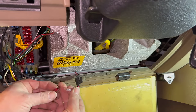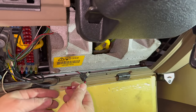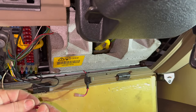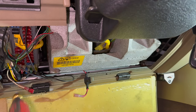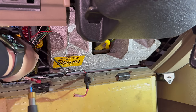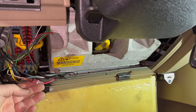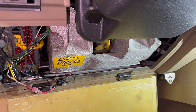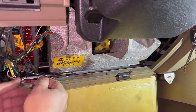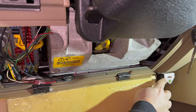I didn't put on this connector so I'm going to make sure that mine will connect to it before I crimp it on — I've made that mistake too many times. Looks good. Now let's try this again. Turn the ignition on — there we go, we got the green light. Wiggle it — no more problems. So now we have the green light for dual on.